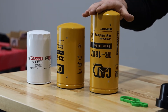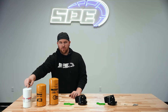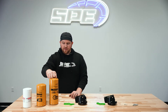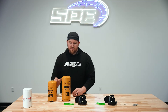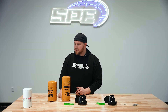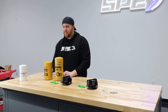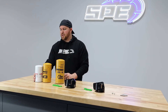Obviously the micron ratings are better with the CAT filter. The FL2051S is actually only 80% efficient at 20 micron. The CAT filters are 100% efficient at 20 micron, and at 4 micron they're 20% efficient. The reason we have two different styles of CAT filters is if you're trying to get the most mileage out of your oil changes, running expensive oil, or want longer maintenance intervals, the larger one is obviously going to perform better. The smaller one is the same micron rating but smaller in volume, and if you don't want the filter hanging down as far, the shorter option is really nice since it's not a whole lot longer than the factory unit.